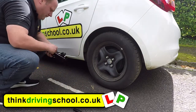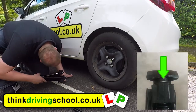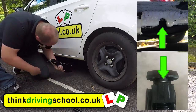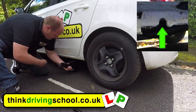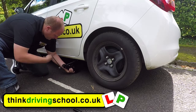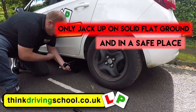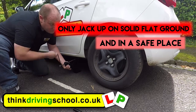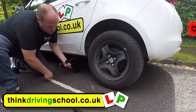The next thing we need to do is jack the car up. As you can see on the top of this jack, it's got a raised bit. The raised bit is going to go into a groove underneath the car. Your handbook will show you exactly where it is on your car. Car jacks aren't the most heavy duty, so it's very important that you support the jack and take your time with it to make sure it's jacking the car up safely. We're going to jack the car up so the wheel's off the ground by about a centimetre or two, so there's plenty of clearance to get the wheel off.